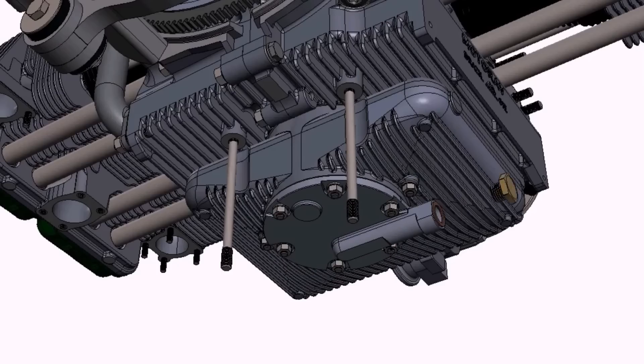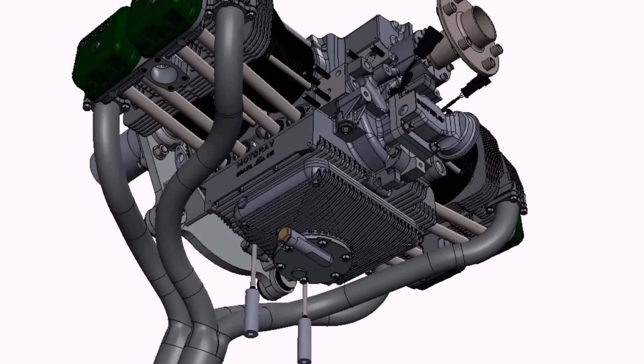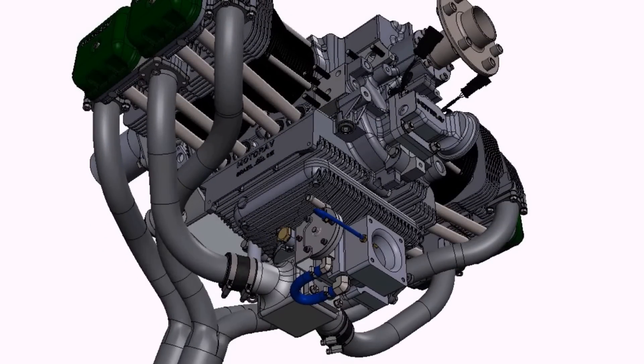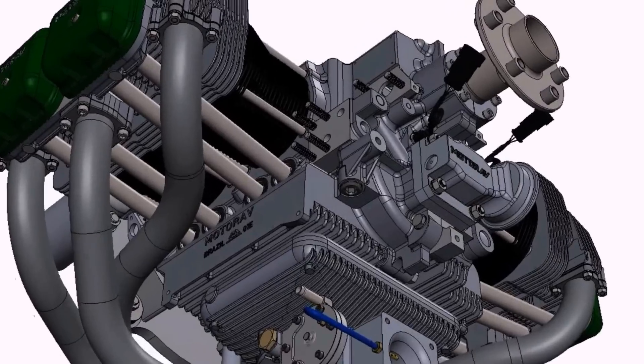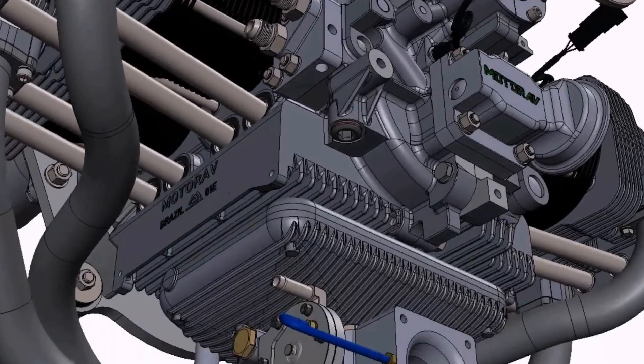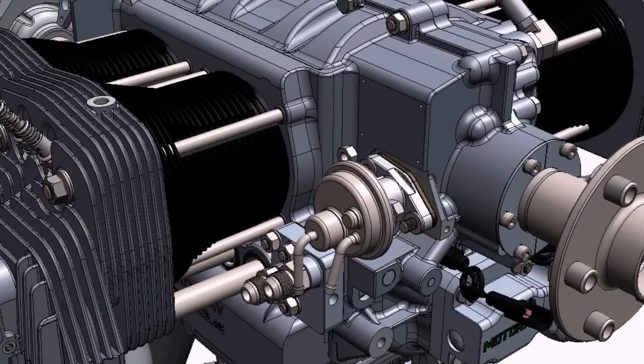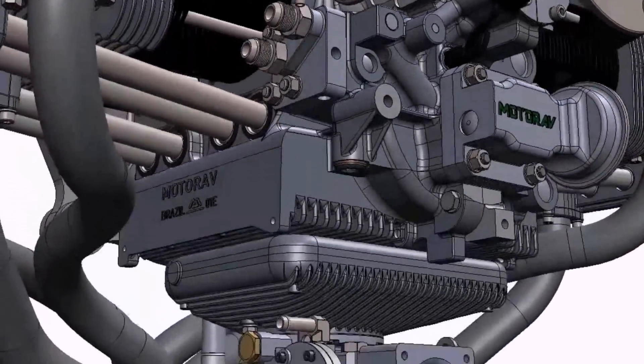You can fly normally at about 75% of power, about 2,600 RPM. That runs real smooth at that RPM. When you are running at 2,600 RPM, what fuel consumption do you have? Around 18 liters per hour — so about four and a half gallons an hour.